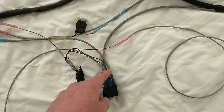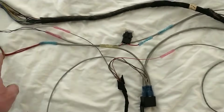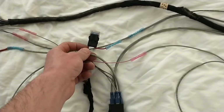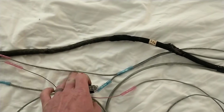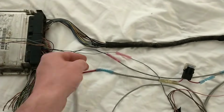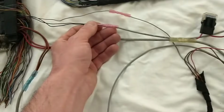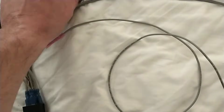And then, so once that power is coming in on this side, it's kind of crossed here, but once the relay kicks on, that's going to feed your main power to your ECU. And I also tie it off of that, and when you do that, you want to put another smaller, like a 10 or 15 amp fuse on, and that is going to go to all the other wires that need power. And so you could do it different than this. It does look a little confusing here, but on this main, the bigger plug here, there's going to be two wires coming right off of it that were kick-on power that they need. That's going to be your blue and yellow and your black and purple. So I've got those tied there to come on whenever the relay kicks on through the fuse. And it also gets fed this way.